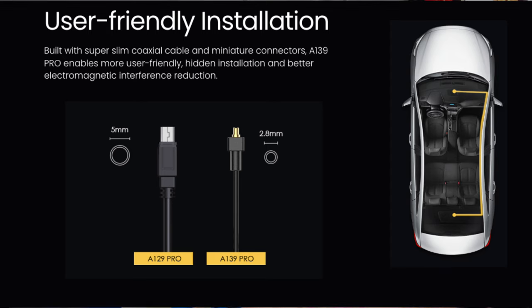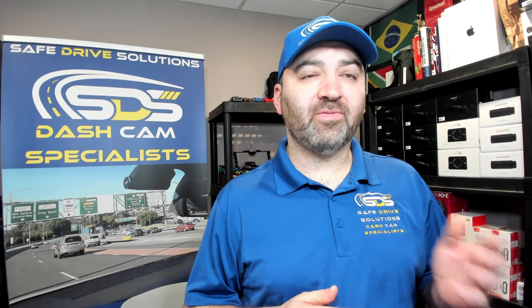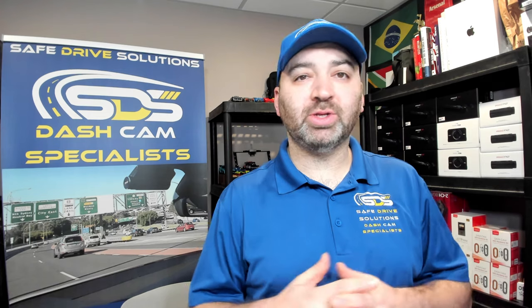Dash cam cable sizes. What I really love about the A139 Pro is it actually uses a very small cable run from the front to the rear if you are doing a two-channel setup. The current cable on the A129 Pro is about 5 millimeters in thickness, and the A139 Pro is actually using a 2.8 millimeter, so about half the size in thickness. It makes it very easy to run from the front to the back, especially for people who may be trying to do it themselves.